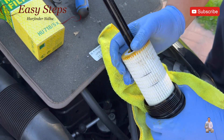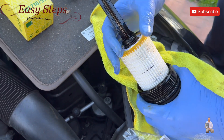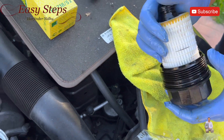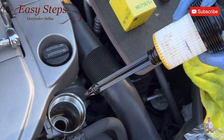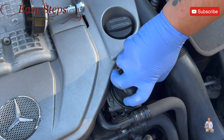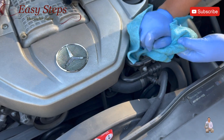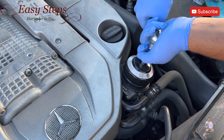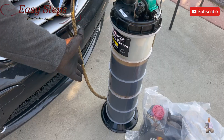Now, lastly, install the oil filter. Squeeze it down and it will line up with the line. Now install it back. Once it's hand tight, use the filter wrench and do just a quarter turn. Then reinstall — the oil has been sucking out the whole time.